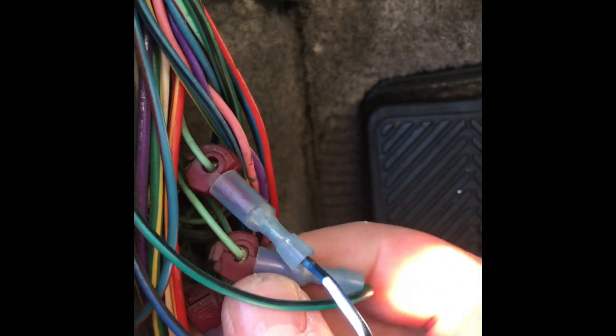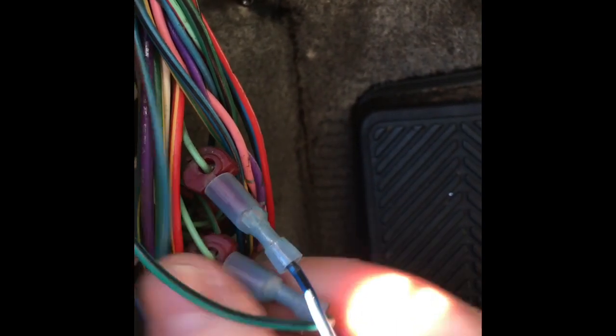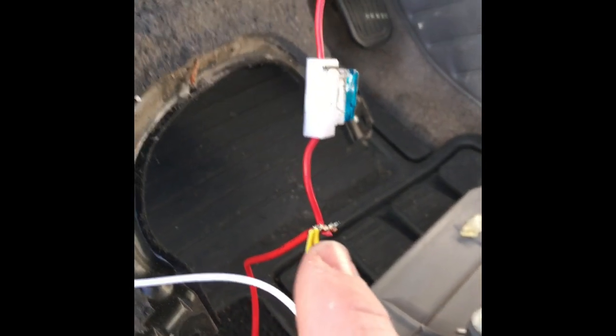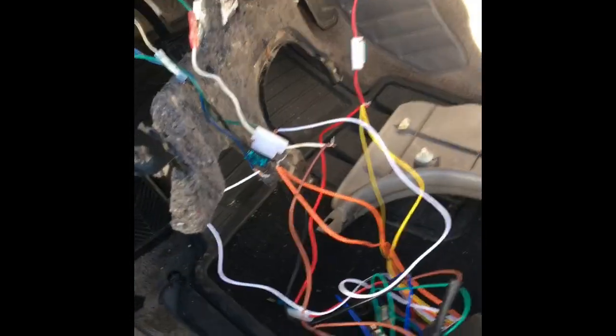white wire. And then you've got this green and black wire that hooks into a teal, just a teal again, another teal wire. Then they come back into the white and white and black. Then the ground is the orange, and I had to power the yellow with power from the console up underneath where it hooks into the ignition. And the brown wire goes to the lights.